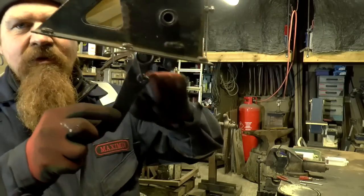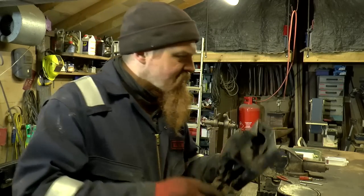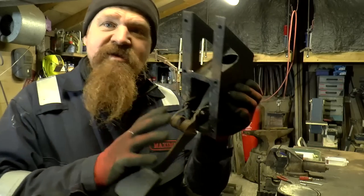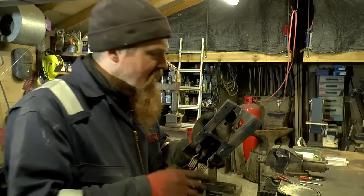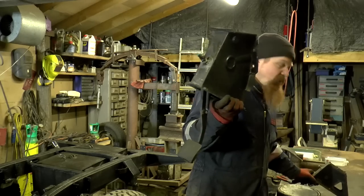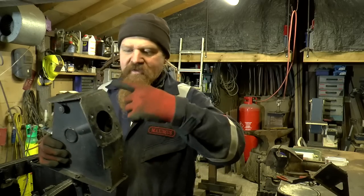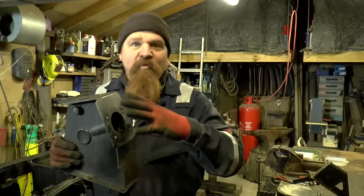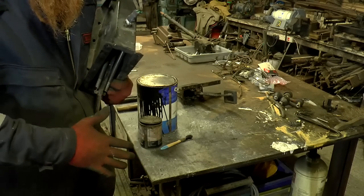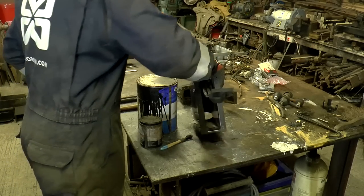So you've got a spring here, which works very differently. So the series spring is just, well, it's like this. It's just a return spring. With this setup, you apparently have a much lighter clutch, which can only be a good thing. So when I found this, it came as a pair with the brake pedal box. And that worked out pretty well because I'm going to be fitting the servo and the master cylinder all brand new and not series 3 either, so this should all go together. The action is really nice, no play in there, and it's smooth as you like. So a good purchase, as it turns out.